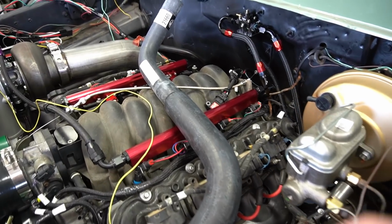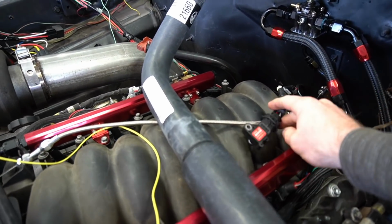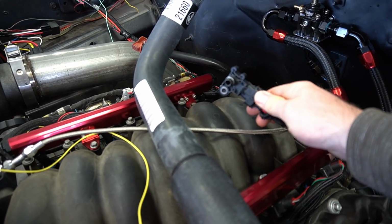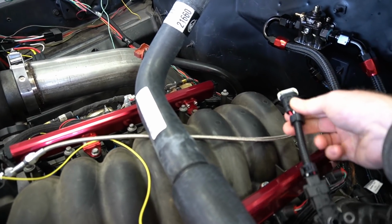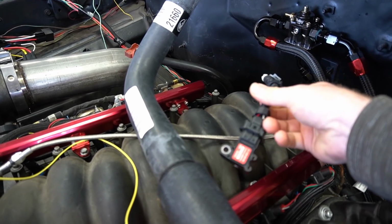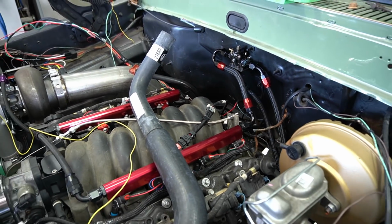The map sensor, of course the LS1 map sensor, I think only goes to 1 bar or something. So I bought a 3-bar map sensor out of like an LS3 or something. It is actually not compatible with this LS1 harness, so I had to go find an adapter harness, which a lot of guys on the Amazon reviews said they've used with this Holley swap to make that more functional and actually work.